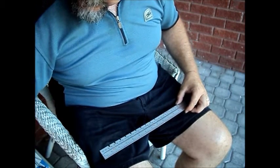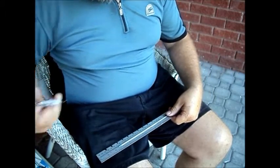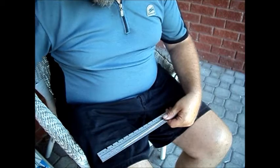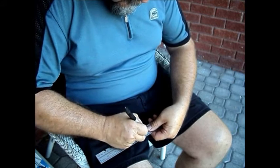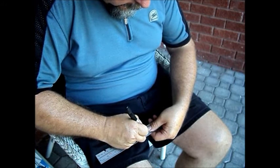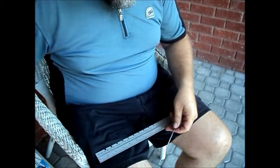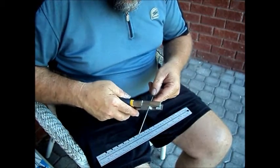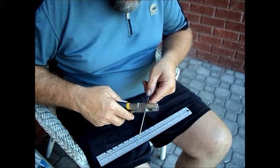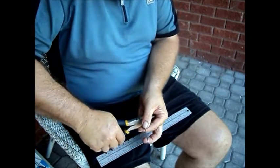The first thing we're going to do is cut our spokes to length, using a spoke ruler, a sharpie marker, and a cross cutter. Carefully mark our length — in this case we're going 186 millimeters. I like to mark them and cut right away instead of marking them and putting them aside, because if you do that they might rub on each other and the mark can become obscured, so I like to do it right away while the mark is clear.